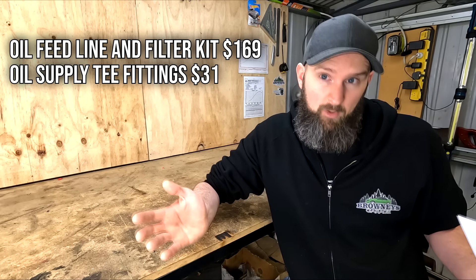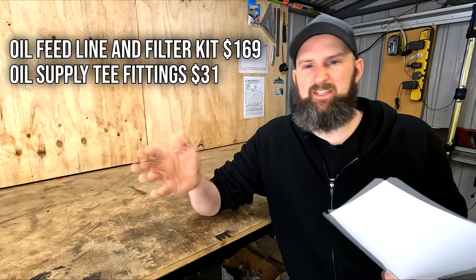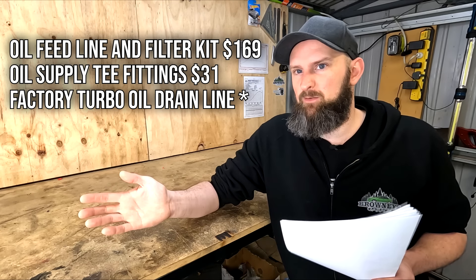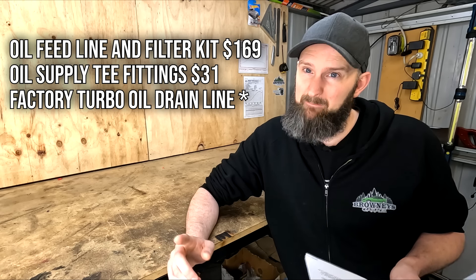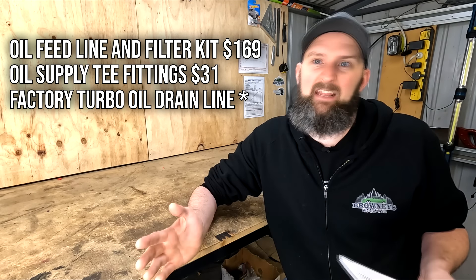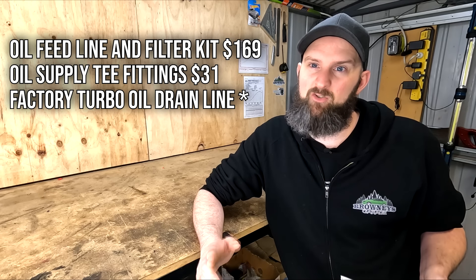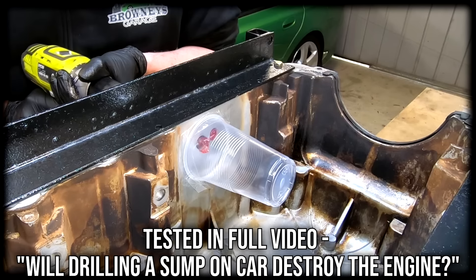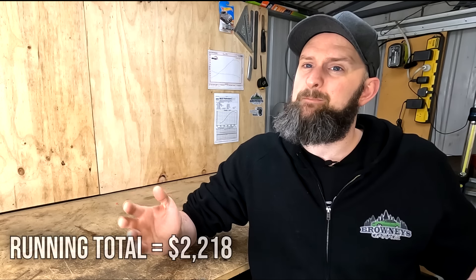If you are even more budget-minded and just wanted turbo noises, you could try the factory wastegate actuator and get the 3 or 4 psi they're set for, or add a basic controller and you'd be back at a similar price — but those stock actuators are getting pretty old now. That turbo now needs oil and ideally wants coolant as well. Oil feed kit was from Antz Performance and was $169. That tees into the oil temp sensor using fittings that were around $31. For the oil drain side I could have used the factory turbo drain which was in the bulk deal. Factory drain is a minimum and it returns into the sump in the same location as the stock turbos — the casting's there for it, just needs to be drilled out and the bolt holes tapped. The coolant line kit was $179 from Mamba Performance.